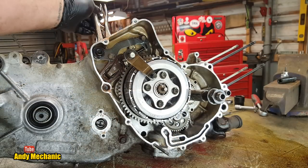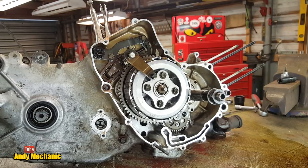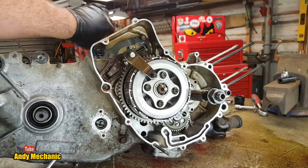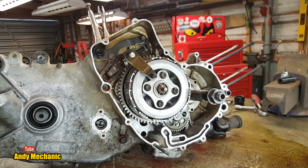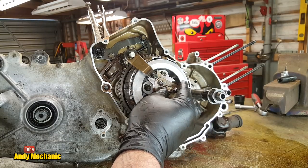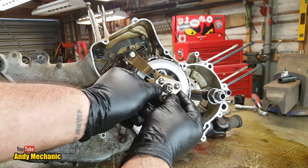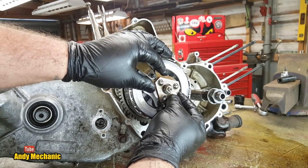Easy. Okay, so we've got Mr. Mole Grips on the shaft. The shaft comes through here. It does a number of jobs. First job is it moves this arm. This is the first thing to move, and it can move either way. And if I get those other bits, now these sit on there like that. Now it's a pretty loose fit, and there's these three ball bearings. Now it's a little bit hard to comprehend, but if I go and get the casing that goes over the end, then you'll get a better idea what's going on.